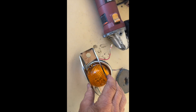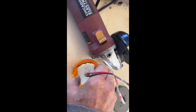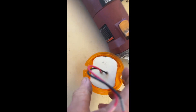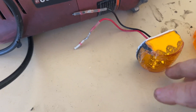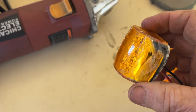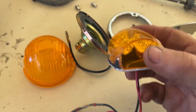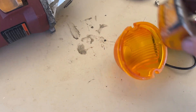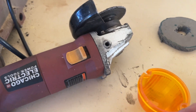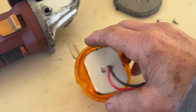So I decided to see if I could do a little modification on this puppy. Took it apart, took everything apart. I took the LED element that was in that other new side marker light — it was way too small — and I just started modifying it, just started cutting it off. It looked pretty much like this but was just really small. I took the LED portion of it out, and it wouldn't fit in the receptacle here — it was too big. So I just started taking the old grinder and grinding off a little bit at a time, just kept rounding the corners off until it actually will fit inside of this.